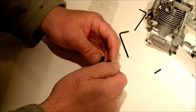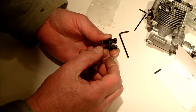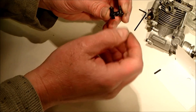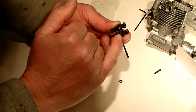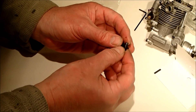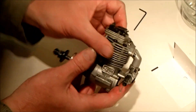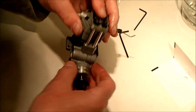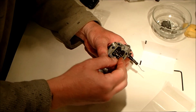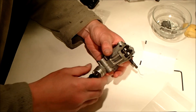The threads are compatible — I suppose with these being clones they literally copied them part for part. The cups look ever so slightly different, but as long as they fit the push rods that shouldn't be an issue. I need to make sure the push rods engage with the cups on the adjusters, otherwise it'll be in for a heap of trouble.